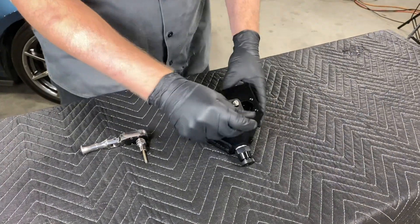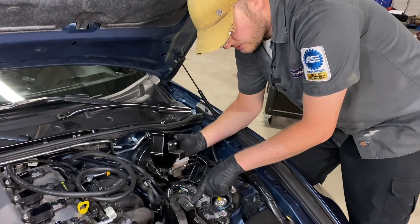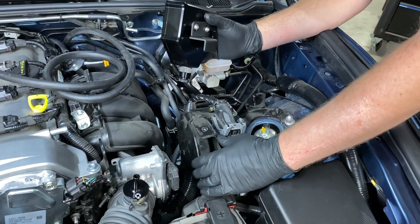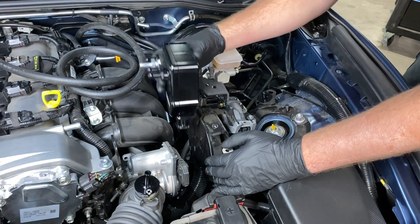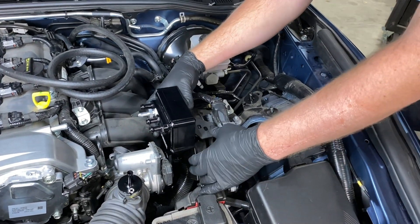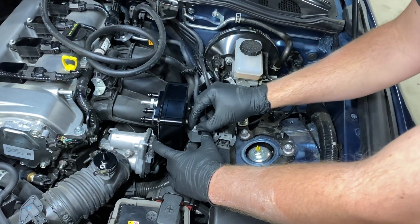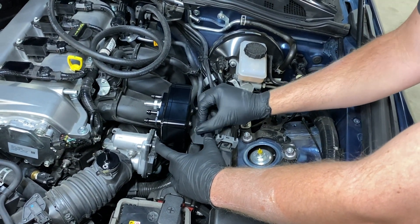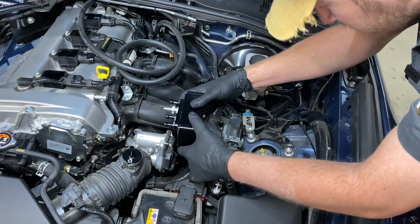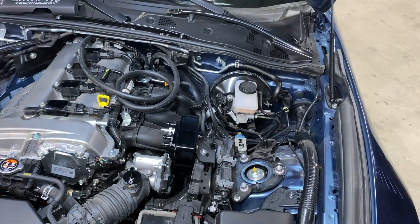The last bolt and washer mounts it in the car. The mounting bracket bolts to the ECU bracket. On the ND2, you might have to kind of tuck your harness block in a little bit. Lay it over, line it up with the hole, drop in your fastener, and try to get this mounted low. Now we can tighten up our fasteners and check for clearances — make sure you're not hitting anything.